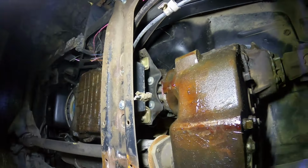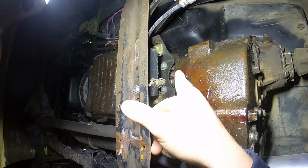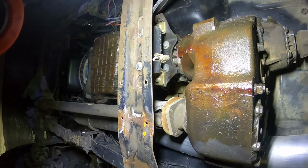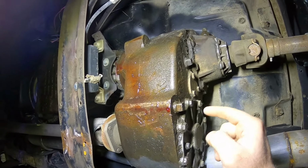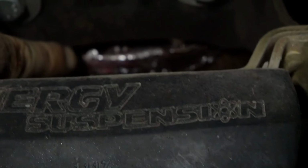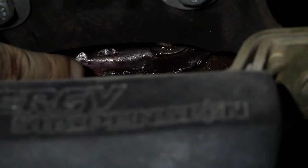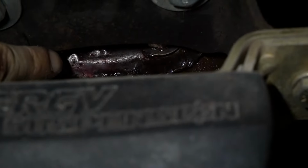See what we got. See, we got a transmission leak already. That's leaking on the transfer case. She's got a pretty steady drip where the transfer case mounts to the transmission. Imagine that. This thing is a heavy son of a gun too. So it's really tough, but right there, it almost looks like weld. And that's where I think the tail shaft of the trans broke. So I'm going to assume that it's leaking there.